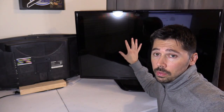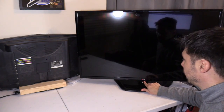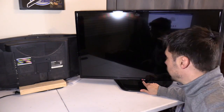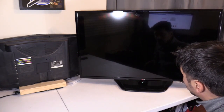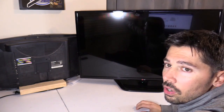If you have a glow from your backlight but no picture, that can be a bad T-con board. When the TV is off, you have the red standby light on the bottom right. When you press the power button, this red standby light will go away, and then you'll get a flash on the screen — the backlight will go on for a second and then turn off.